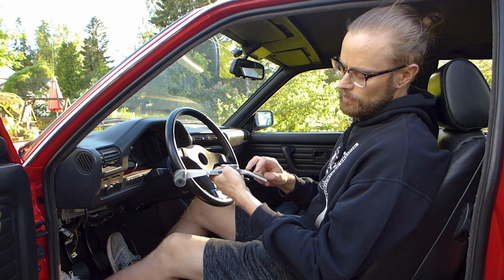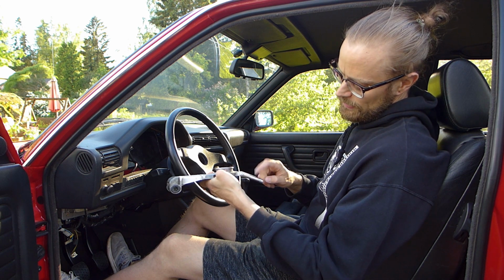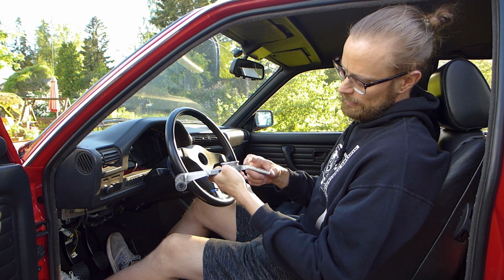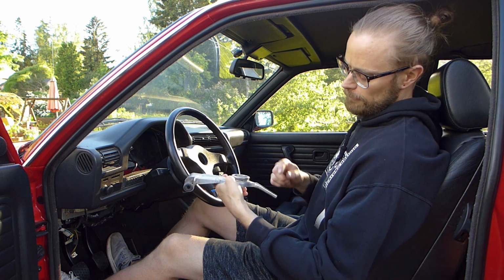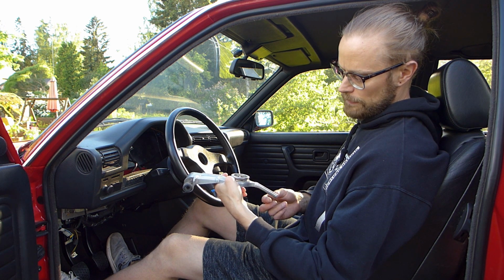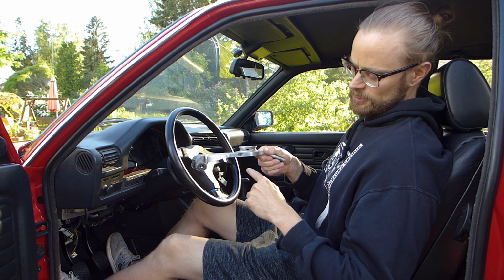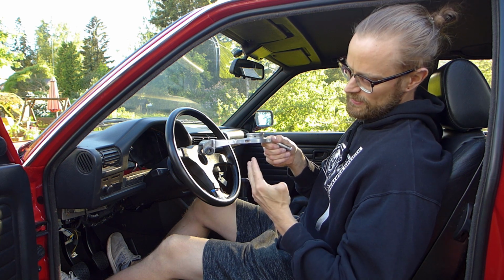Now I also had a welder modify the rear end. Originally this shaft points straight back, but I cut it off and had a welder re-weld it at a quite a lot sharper angle. And what this modification does is, when the rear fixing point remains the same, this pushes the shifter up and hopefully creates clearance between the shifter bottom end and the drive shaft flange, which sits around here.